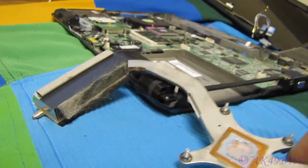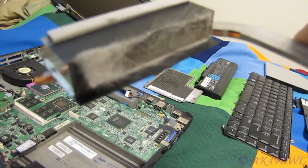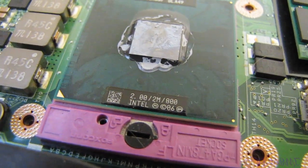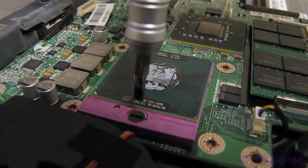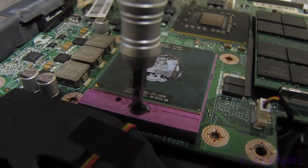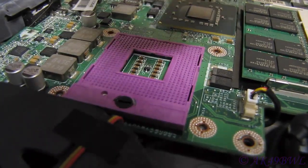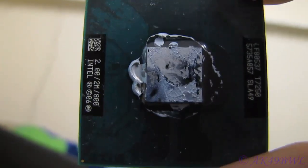Obviously I have not been into this thing in a while — it needs a clean out. I've seen worse, but I usually don't let mine get this bad. Generally everything in here looks good. Anyway, here's what we're going for — Core 2 Duo, 2GB. What we've got to do is turn that, and that releases the CPU from the socket. You can see it move, and now it just comes right out. Not too difficult, really.